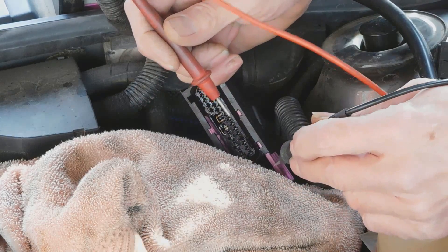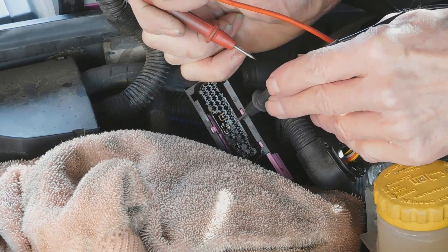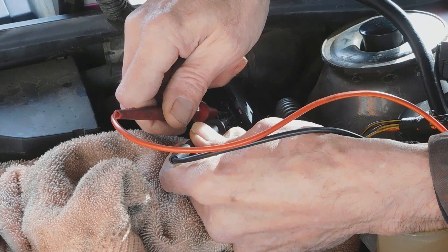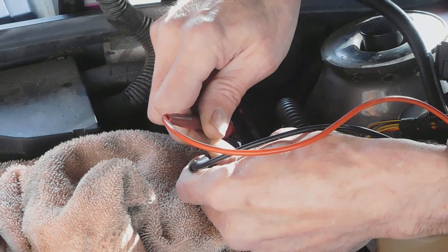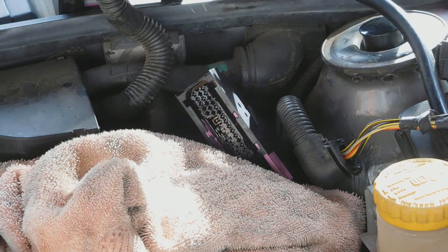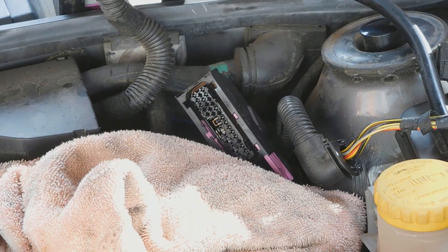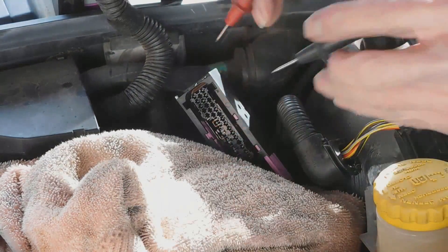The left rear is pins 8 and 9 — and it goes up to 1K. So yeah, pins 3 and 5: 63 ohms on the right-hand front wheel sensor. That's not good. We've got a problem. There are your wheel sensors.